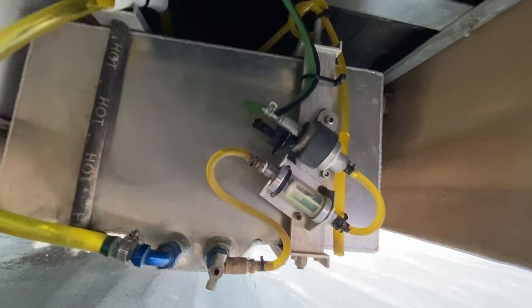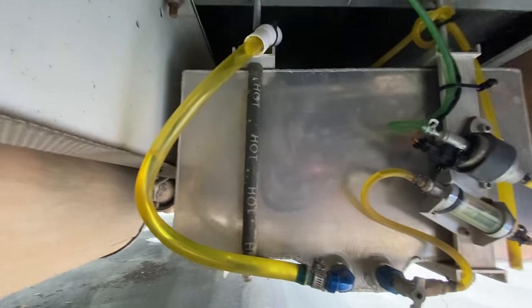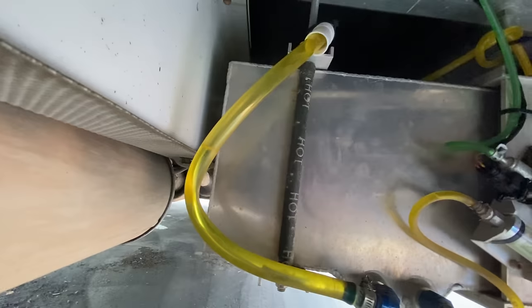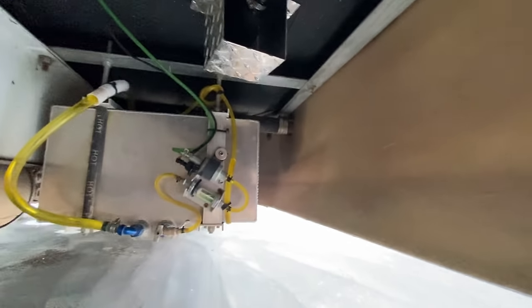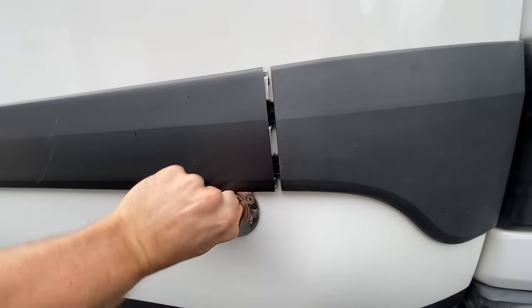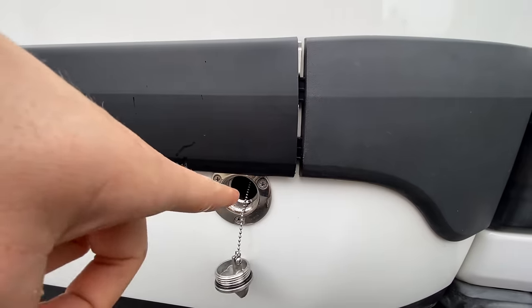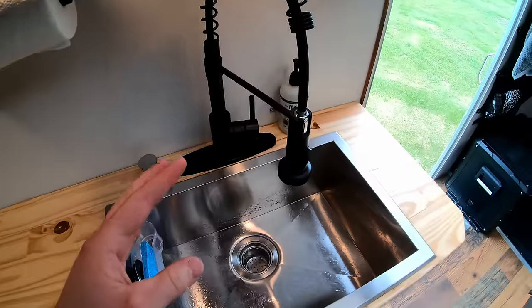There's a little valve on the fuel tank for easy servicing, and a fill neck on the outside so you can use a standard gas pump. A fuel level check line makes it super easy to know exactly how much fuel you have — it's a 10-gallon aluminum welded racing fuel cell with a stainless fuel fill cap. Since the fill is about the same level as the tank inlet, I need a small hose and funnel, but it's a small price to pay for how well it works.